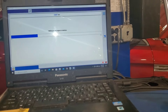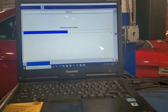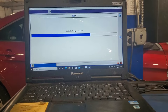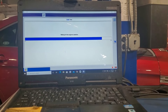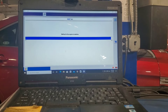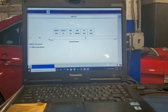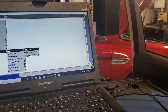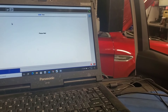The evap system test had me rod the fuel cap with that little plastic filler neck a few times because it said it cannot obtain the vacuum it wants. Go take that white filler neck in the back of the vehicle, shove it in and out of the hole a bunch of times, then restart the test. If that's not the fix, more than likely it's the evap purge solenoid valve. Now there's actually a new tool — under Powertrain, go to Fuel, go to Evap, and under the toolbox it says VBV check.